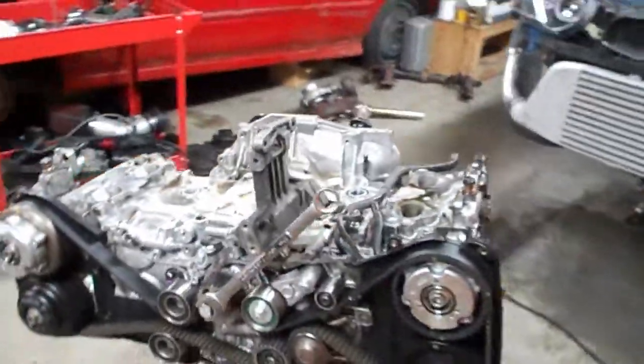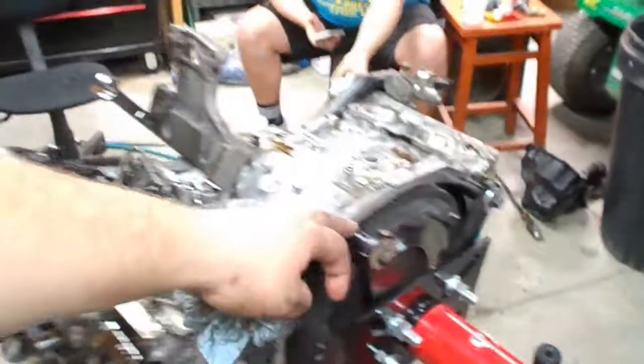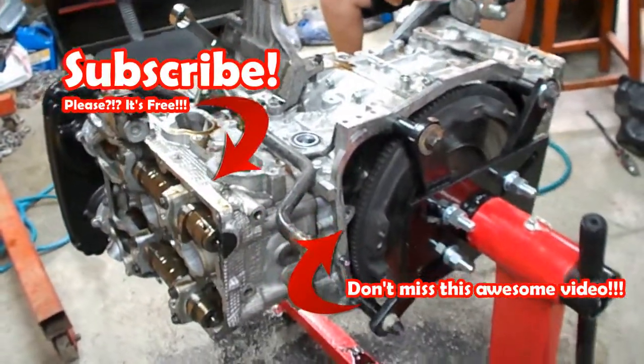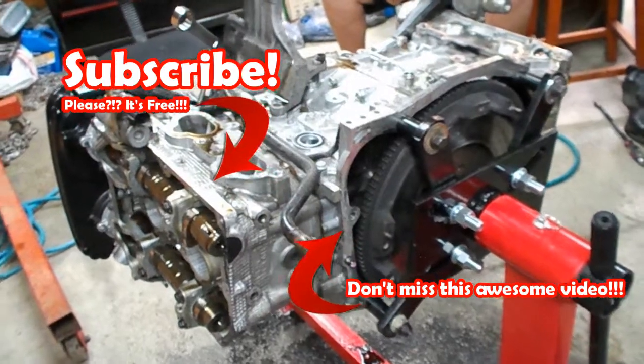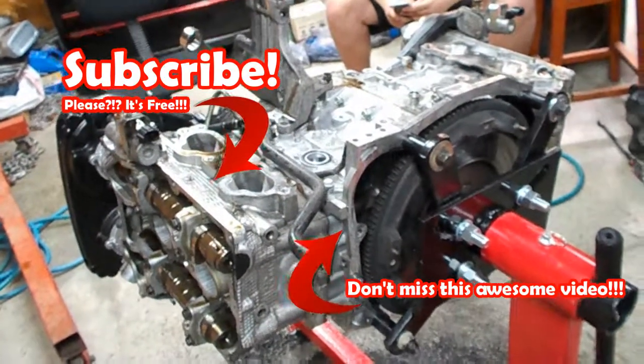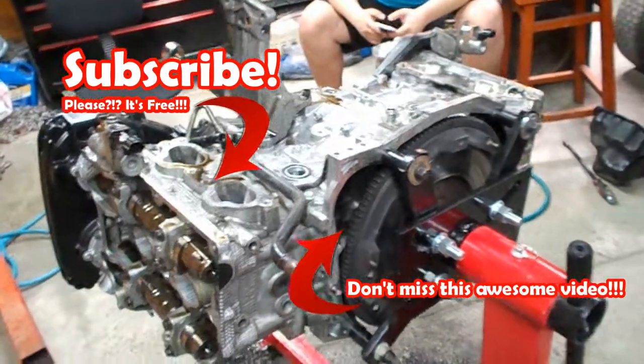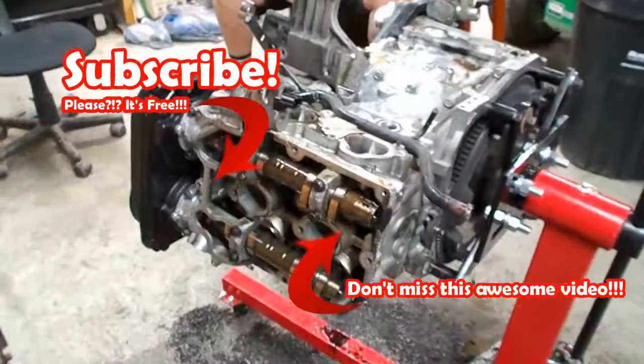So at that point, we'll take it off the engine stand and get the bracket off of it, take the flywheel off, and go ahead and get the block split open so that we can check the main bearings and get the rods out of it and all that.